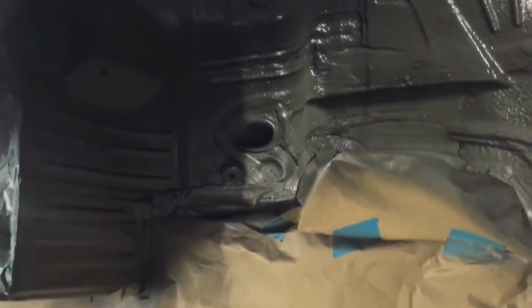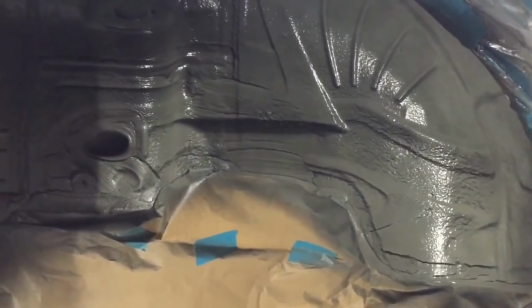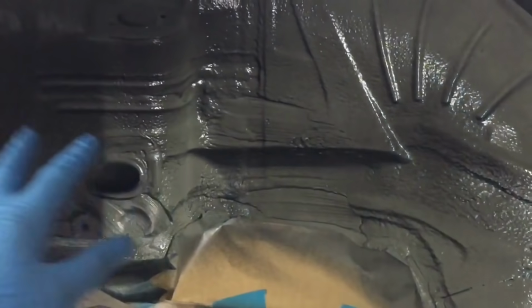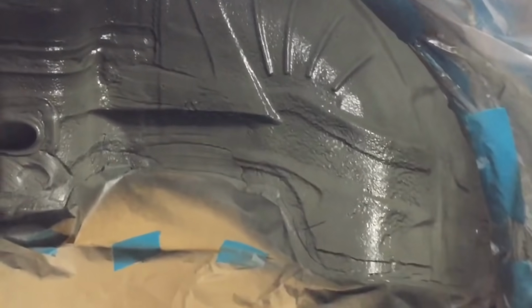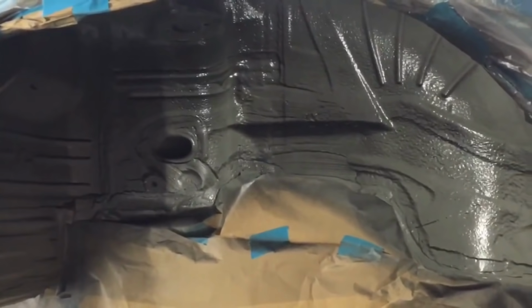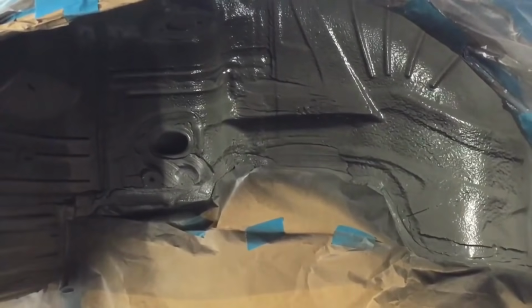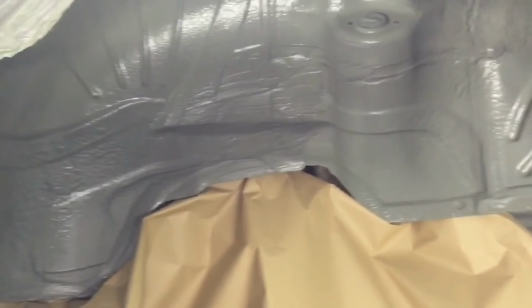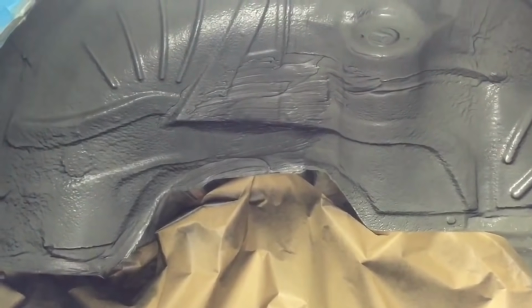Looks fairly factory, just typical dustings from our pictures of when we started the process, of where the factory overspray goes when they're painting the rear panel and painting all this battery box area. There's a larger section of overspray here because they paint all of this black, and then there's some up on the brackets up here, and then a general dusting which picks out all the highlights and curves of the stamped panels. And then there's also a little bit more around this side where the robot would turn to paint the folded arch section all the way up here. So we can just satin lacquer that in now, clear coat over the top, and then we'll be completing the spray section. So just a quick reminder of what it looks like, the olive green. And there it is with the sapphire black dust coat.